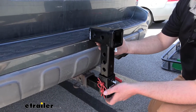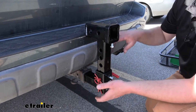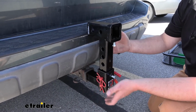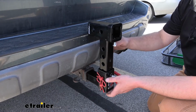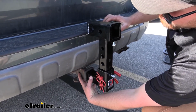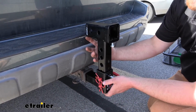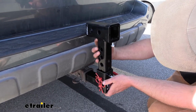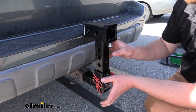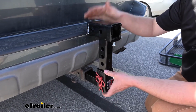Whenever you have it in that lowered position, shouldn't have any issues at all, because obviously your bumper is not below your hitch. But that being said, just something I wanted to mention with it in this position, if you do plan on using it like that, something you might want to think about. So to give you an idea, what you can do is measure the distance from your hitch pin hole in your hitch to the edge of your rear bumper and figure out that clearance, and the clearance from the very end of this receiver tube to where the shank starts right here, that's going to be about 2 3/4 of an inch. So you can use those measurements to kind of figure out if you can put this in completely with this all the way up and not have to worry about hitting your bumper. Kind of a unique situation, but something just to think about.